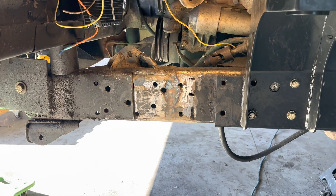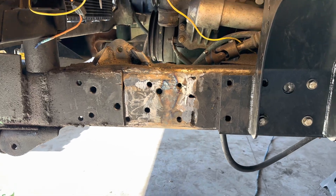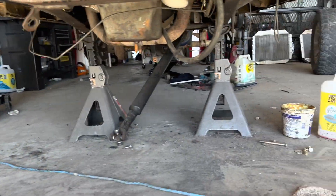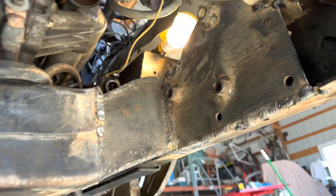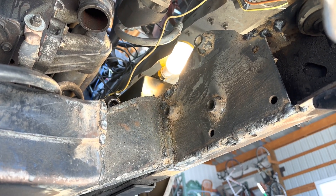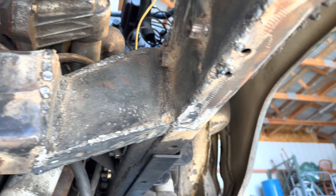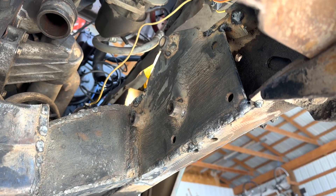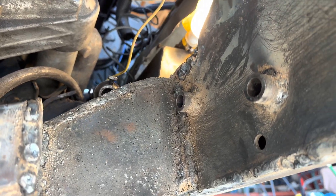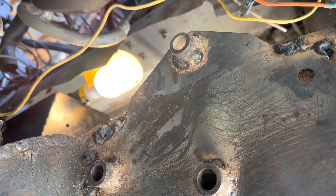Here's what I've been doing for quite a few days. I've done all sorts of cutting — everything's ready to get painted and bolted on. Under here, this is what's required to do the Super Duty axle swap with the Battle Borne Brakes kit. You need to notch out your cross member plate, weld it, and then weld that piece in. Now it's ready for paint — pretty good welds. You can see there's real good penetration on that weld on top of the frame rail.